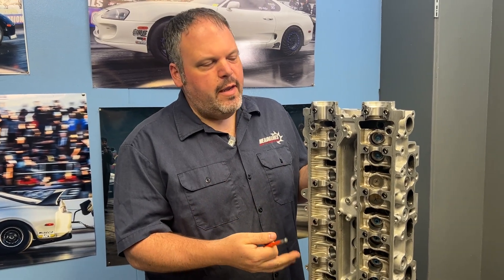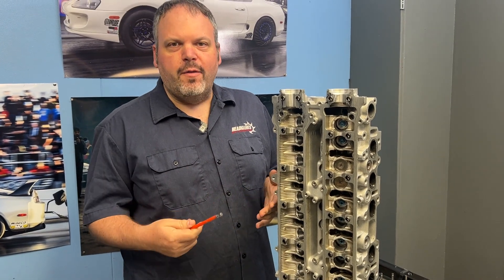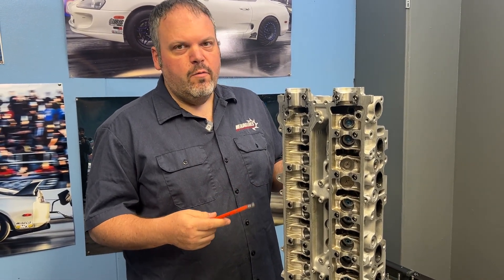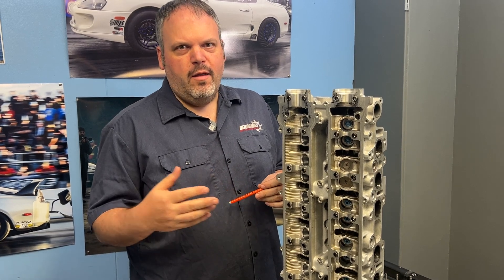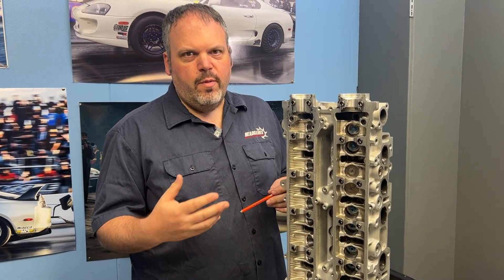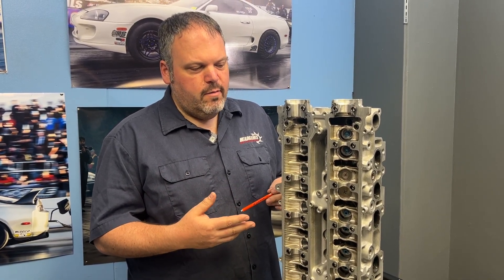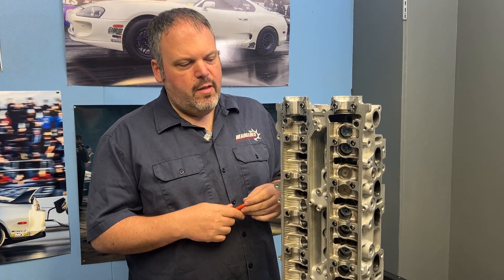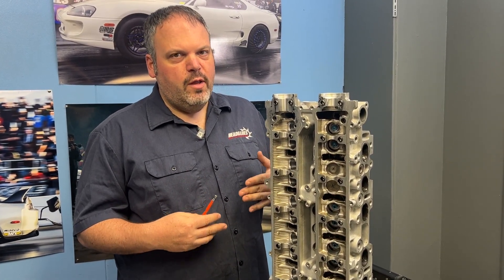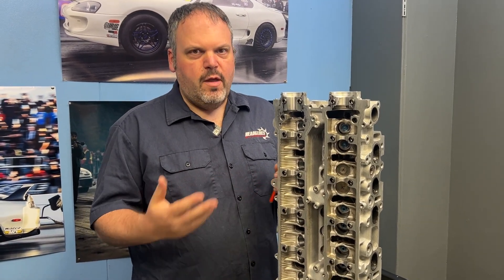So far, what I think is the problem is not in the camshaft. It might not even really be in the head — it could be the installation. I really don't know. If he didn't use the right lube — and I know he had to take the cam out because we had to ship him a bucket — I just don't know really what happened here. At least at this time I haven't figured it out. But I know it's not in the valve spring — we use a 5086, it's a bad dude.